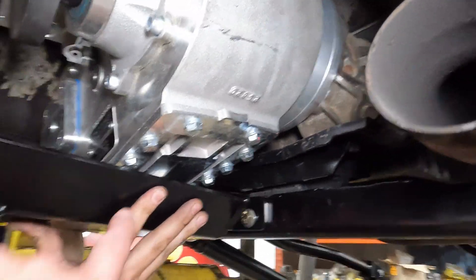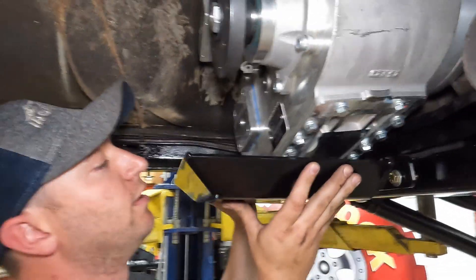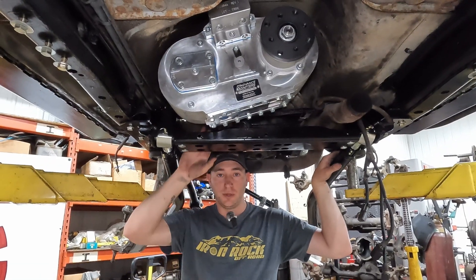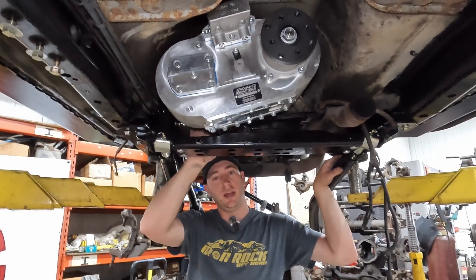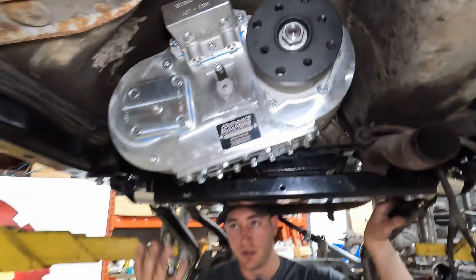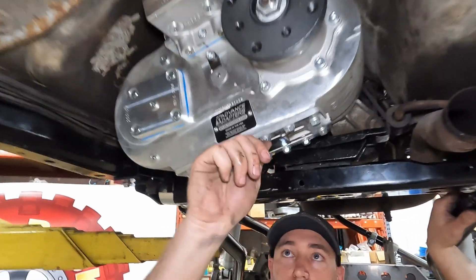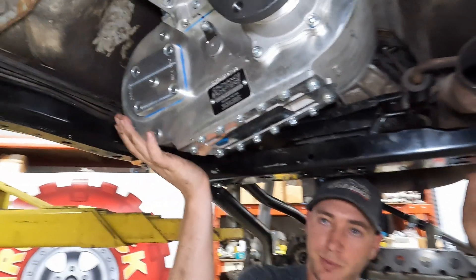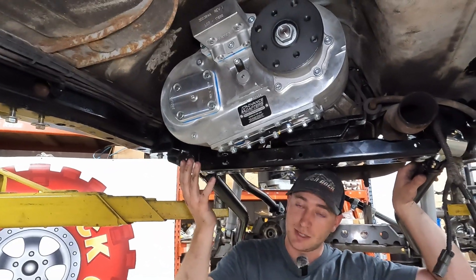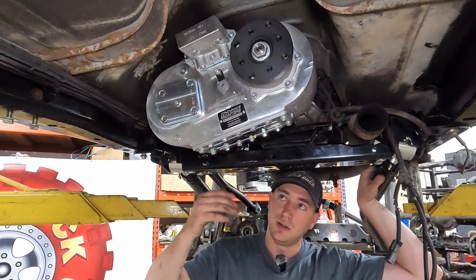It's pretty tight but it'll clear. We've got our three-length front cross member here and the front driveshaft is going to clear just fine. We test fit our 231 transfer case skid plate — it gets really close to one of the bolts but the belly clears with about a half inch to three quarters, which is perfect. The 242 t-case skid will definitely clear, though you'll lose a little belly height, or you can modify a 231 to make it work.